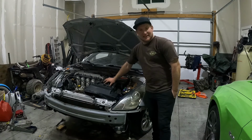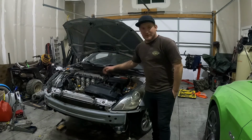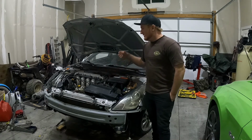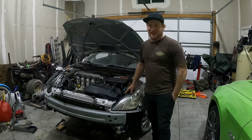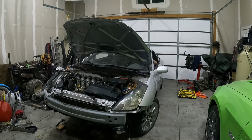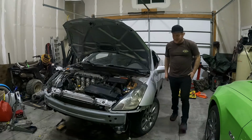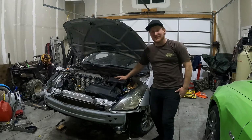There was a gasket in the set, and I had seen a video of how to deep clean it to get your idle lower and to get better air fuel to the motor so you're getting better mileage and everything like that. So, we're back together. Let's go ahead and try and fire this up and keep our fingers crossed. No check engine lights and a much lower idle. So let's check it out. We're already 1,000 RPM lower, it already idles better, and there's no check engine lights, so that's fantastic.